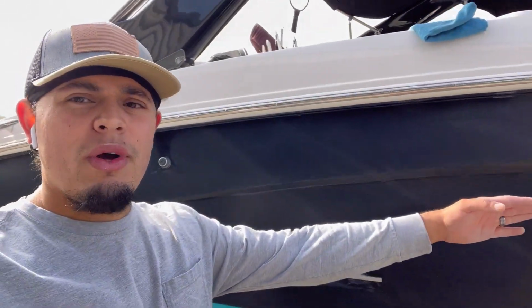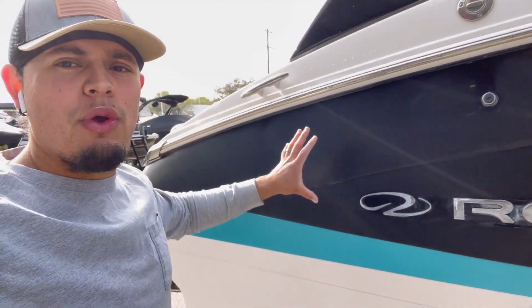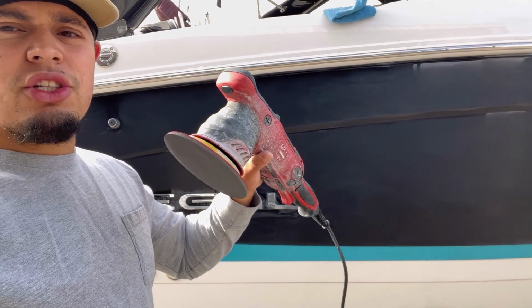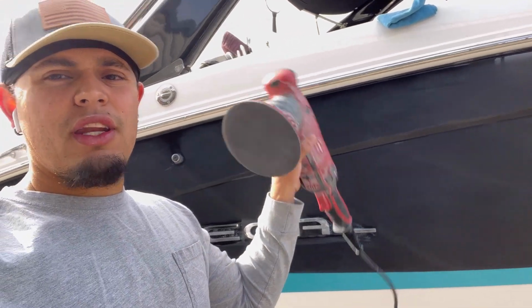So today's a different day. It's been a week. Last week we tried to just buff it off, and some oxidation wasn't coming off the boat. So we started wet sanding right now. We just wanna wet sand all of this part right here where we're having a lot of oxidation issues. We are using our forced orbital polisher with a 1000 grit sanding paper. I'm gonna put all the products in the description, either at the end of the video, or I'll put the link down below.